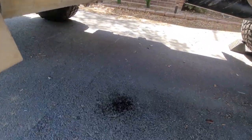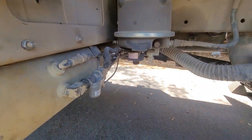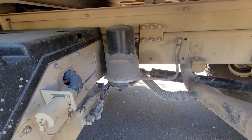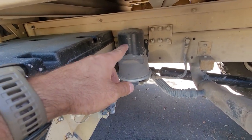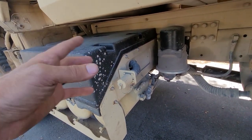You can see it's actually a little excessive today. I started the truck quite a few times letting it fully cycle, so I probably caught a whole bunch of it, but it's spitting out a lot of moisture — it's kind of whitish, so it's oil coming from the compressor. Before assuming the compressor is bad — because I build air pretty quickly — there's a little check valve you can put in up there that's supposed to help prevent bypass oil from getting up here. I'm going to try installing that and do the service on this, changing the packet and the O-rings. It's worth a try — it's not very expensive, and it's something that new compressors ordered from Haldex are coming installed with now.